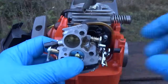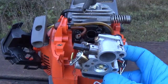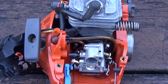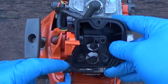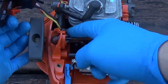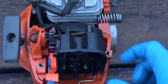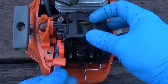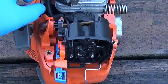For installing a new carb, go ahead and put your throttle linkage back on, then put your choke lever back on. When you're putting the carb back on, make sure your fuel lines aren't getting pinched or squeezed in between the air box. Swing the air box back over — there's a little notch on there, and you want to make sure the choke knob rides on top, not on the bottom, otherwise it won't work correctly. There's a little rubber grommet right there — once you get everything back together, make sure the wires are inside there; that's what prevents burning. Make sure you didn't accidentally disconnect your kill switch. Test the choke for function: pull the choke lever out, push back in on the throttle linkage, and it should click back in on its own. Make sure the wires are back in their little home so you're not burning rubber later on.